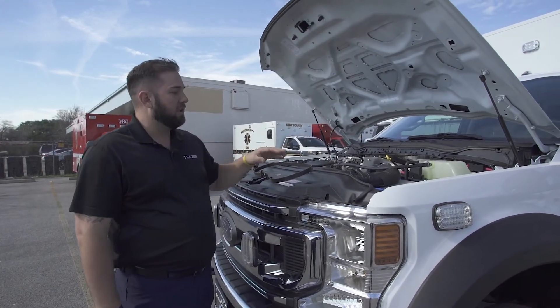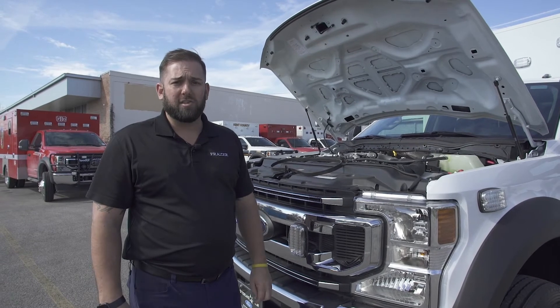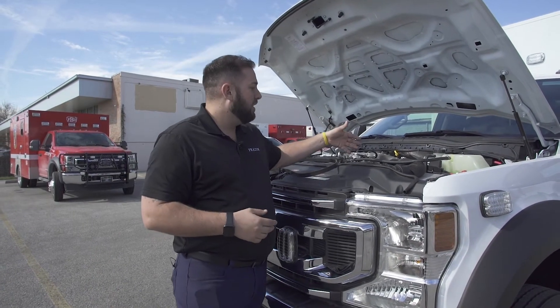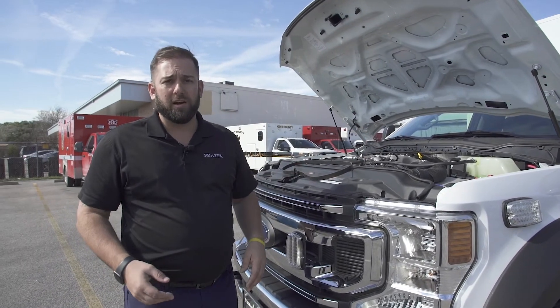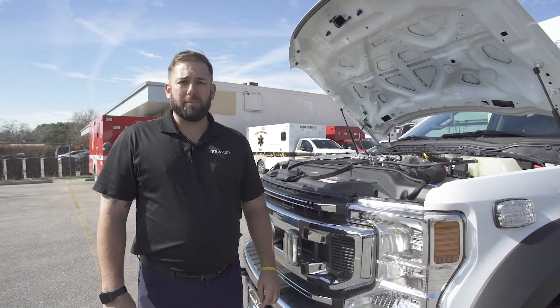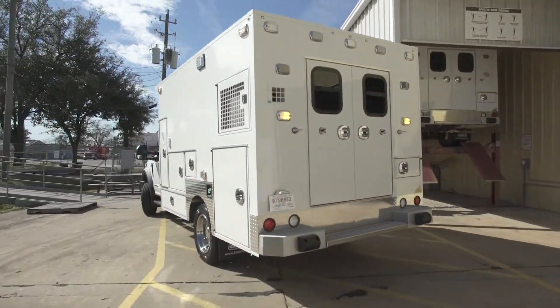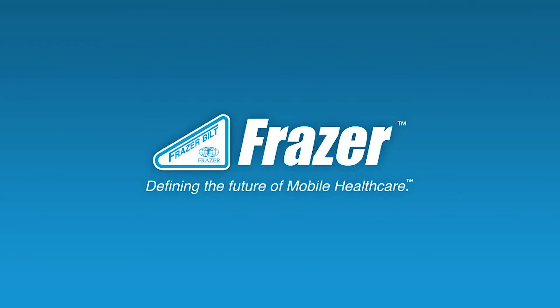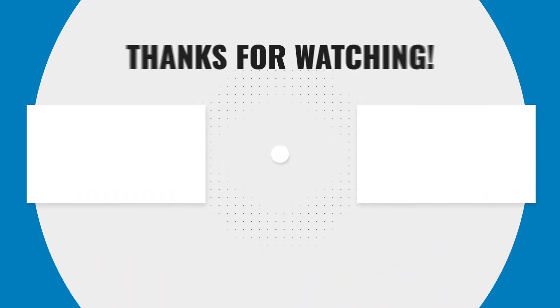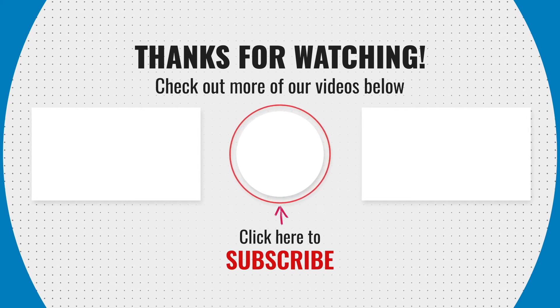Then reinstall the generator, put it all back together, start the truck, listen for bearing squeal, and visually inspect to make sure the belt's tracking correctly. You should be ready to put that back in service. For those wondering, swapping that generator out is like the equivalent of swapping out an alternator — think of it at about that level of work. And that's it — that's how to care for your MAP system.